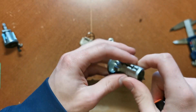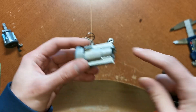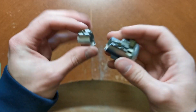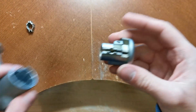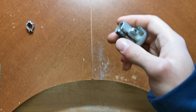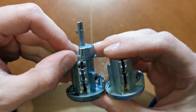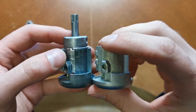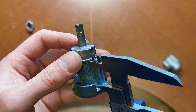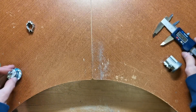I did actually start before taking the video, then decided that video is a better option than just photos. With all that cutting done, we find it's going to almost fit in there but you can't quite get it in all the way. The main reason is there are a couple millimeters difference right at the end of the barrel, so we just have to knock that down a little bit. There's also a little step here that measures about 26 millimeters, so we'll just get that taken care of.